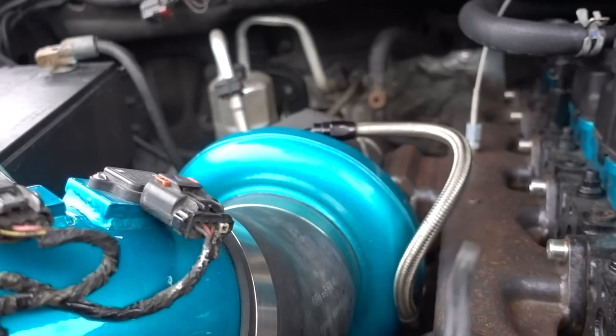As I mentioned, this truck does quite a bit of towing. The second reason I got this specific turbocharger: between the trailer and the truck, it's about 15,000 pounds. I didn't want to choose anything that was going to make the setup laggy, smoky, or have very high EGTs. This turbocharger in this configuration has proved to be nothing but amazing. I have never once worried about my EGTs — I've climbed extremely big mountains accelerating with the trailer on without worrying about it getting hot, and it has not been smoky or laggy at all.